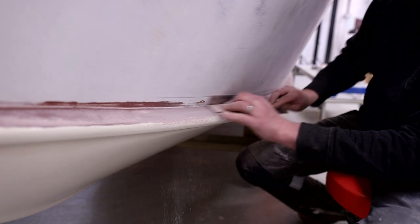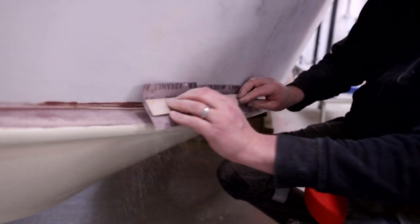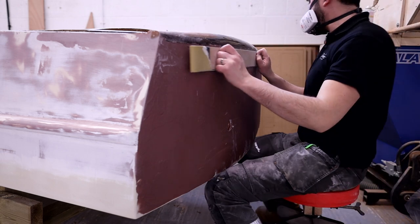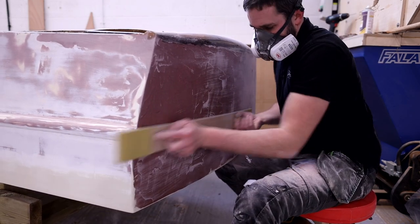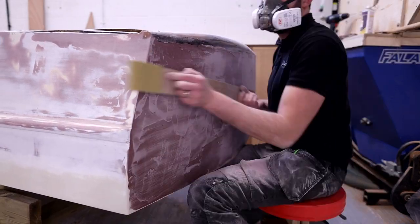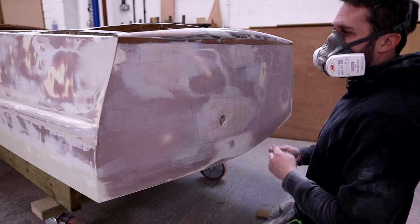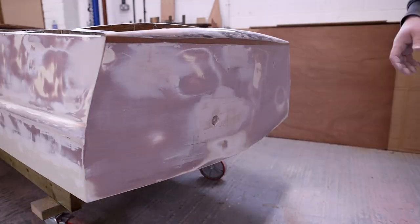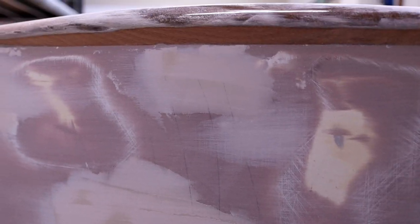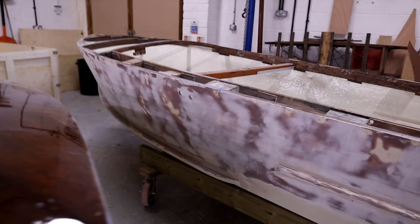Then we're on to doing some more shaping work on the outside of the hull. From the previous video there was still a bit of work to do on the transom, so I set about doing a little more filling and fairing on that. It's not as mountainous as it may look — a lot of this filler is coming back out. We're probably only talking two to three mil in the deepest areas on this transom, but it took several rounds to get it nice. I'm running a pencil line up and down and that indicates what I'm hitting with the fairing board — it takes the pencil lines off the high areas and leaves them in the low areas.